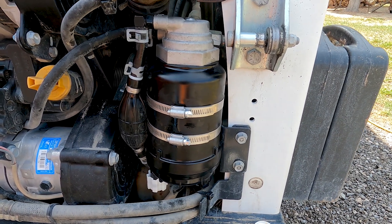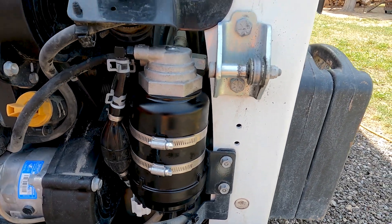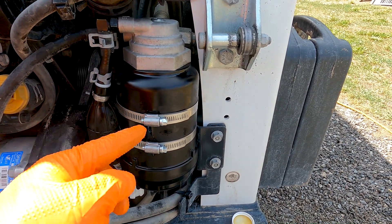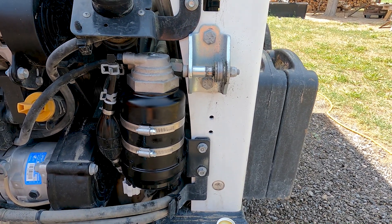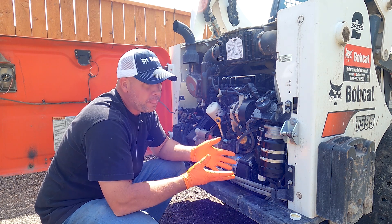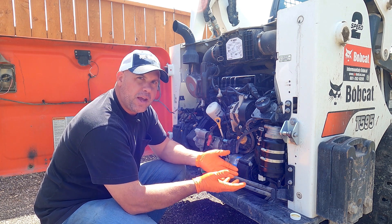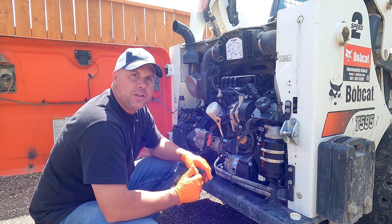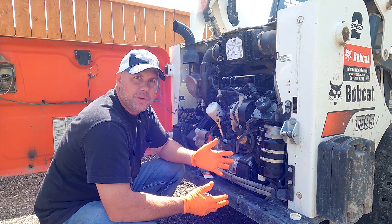So there's our new fuel filter installed, and yeah, it fits. When you get your worm gear clamps, make sure they are perfectly in line with each other when you tighten them. So if you had any concerns about the new fuel filter, hopefully that clears it up for you. It does fit in there just fine, and you just get more water separation — more capacity in the filter to help separate that water and keep it from getting forced through the element into your fuel system and killing your injectors. Any questions on that, let me know. Thanks for watching.